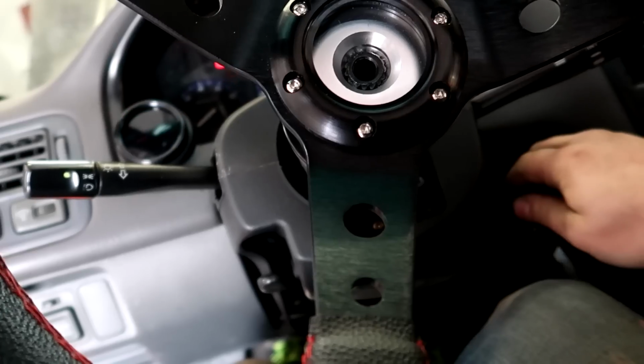But we're going to try to line all this stuff out before we add any more boost, because then we're prepared going into adding power. I would rather try to get the tune lined out on lower boost and make sure the ignition timing is where it's got to be and everything like that before you go add a ton of boost to it.